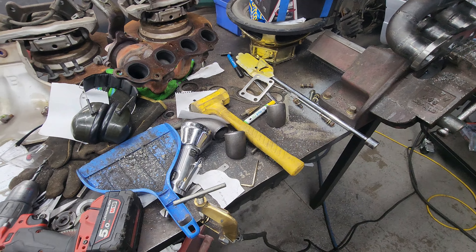I've rejigged the manifold and now the turbo is actually straight, or very very close to it - and it is straight and square this way as well as far as I can tell. I'm much happier with that placement. It's obviously just a tiny little bit different to what it was, but it now sits a lot better. It's incredibly close to that strut bar - probably like 10mm - but if this engine does move it should move backwards so we should be fine. We are just sitting on this heater line down the back here but I can move that.